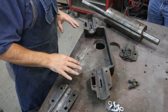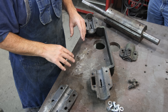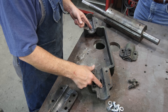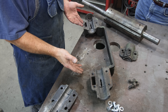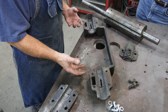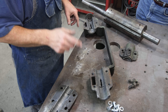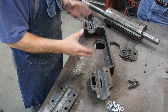When he brought this in, I just kind of spun it by hand loosely — the caps weren't tight — and I'm like, that doesn't really feel that bad. It felt pretty smooth. We took it apart and I started looking at the individual bearings. These little slots down here in the bottom — this bearing housing actually has a little cavity underneath as a reservoir for oil. In this little slot you would have had a wick, usually a piece of felt, that would wick that oil up from the bottom and rub against that shaft constantly, making sure that shaft had a real light layer of oil on there.